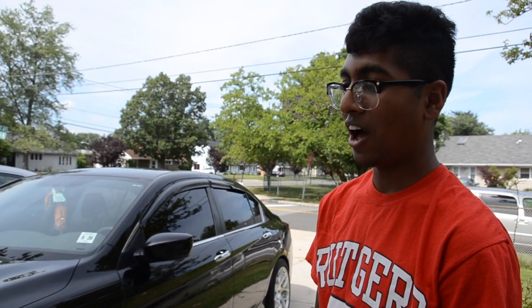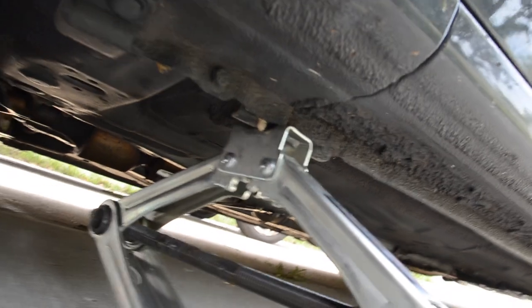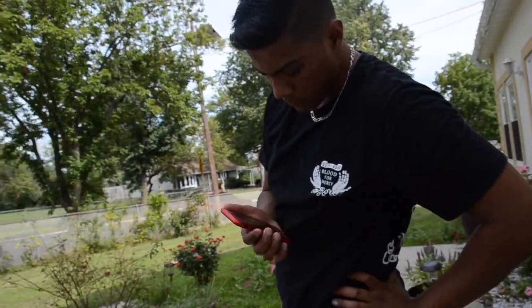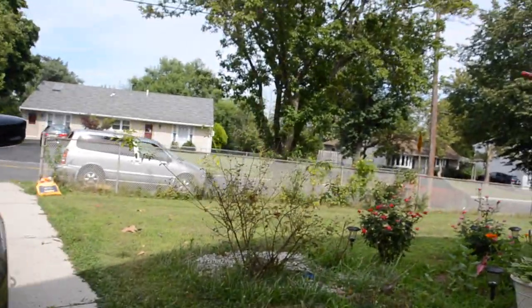I have my jack but I don't have the pipe to actually lift it up, so we just use the one that came with the car. If you didn't know where the jack points were, there's one right on this side right here, right where that jack stand is, and the other one is right over here on this side — same exact place. You could either lift up the car with the jack in the center, or do what we're doing: use the jack that came with the car and lift it up from the side jack point.